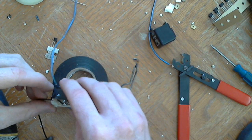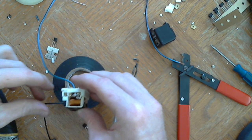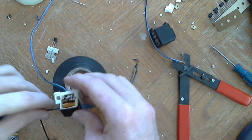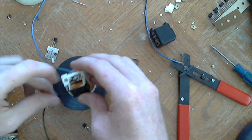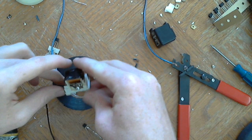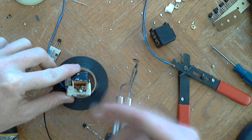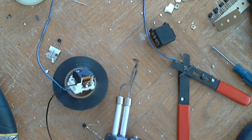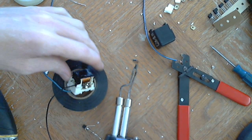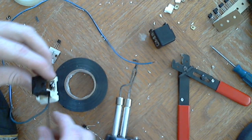Alright, so that's 2. And that little resistor between the 2 pins is still connected on the inside. If that resistor comes off, then it basically won't work at 12 volts anymore. It would be working at a different voltage. The resistor is wired in series with the coil, so it's there just to drop the voltage from whatever the coil would operate at if it doesn't have a resistor. So that puts it at 12 volts. Got that coming out.